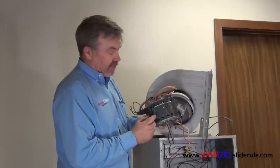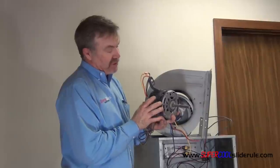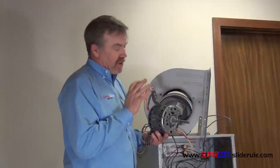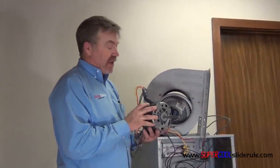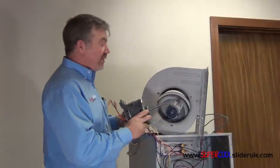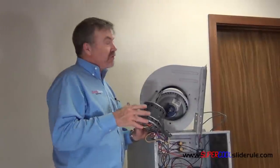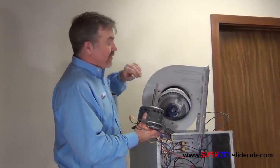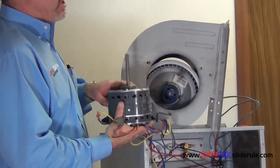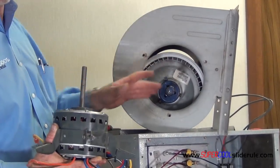To remove the belly band, remove the bolt here. Pay attention to where the old motor was in relationship to the band — we're just off center a little bit. Once we remove this band, we can get all the specs on this motor and replace it. Note the rotation — this motor is what's considered a reversible motor; it can spin either way. There will usually be an arrow marked on your housing. If there's no arrow, the rotation of the fan always goes from the smaller dimension toward the wider dimension.